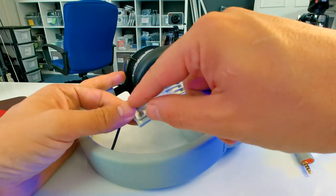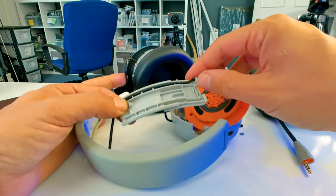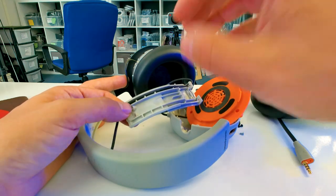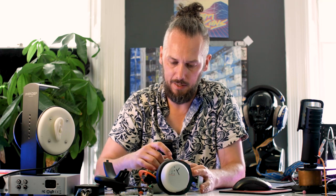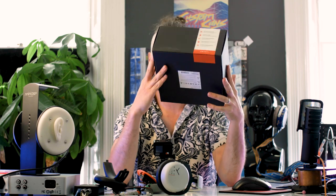Under here you've got this part with a channel in it which holds the cable. These are marked left and right so they won't be symmetrical - because you've got it all cut out here where the cable goes through. They could have made this part symmetrical and saved themselves a bit of tooling cost, but they've spent a bit more by having to tool two separate parts. It does say 'made in China' - interesting, because most Beyerdynamics are made in Germany. Let's see what it says on the box: 'designed and engineered in Germany, made in China.' Looking at it, it's put together like a lot of Chinese headphones - they often have lots of tiny screws, whereas the Beyerdynamic ones usually don't. I think they definitely had some input from their Chinese partners about how it was going to be manufactured.